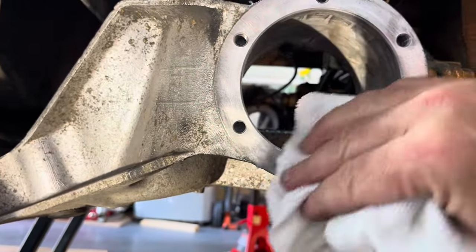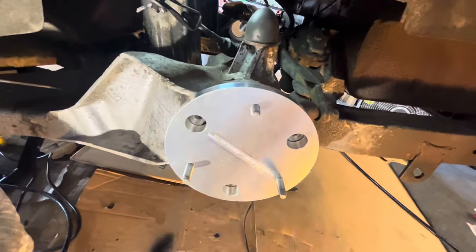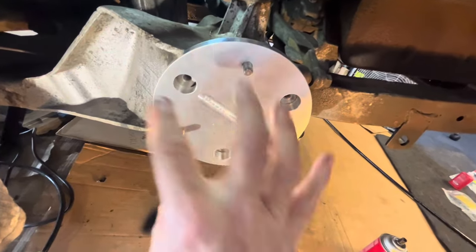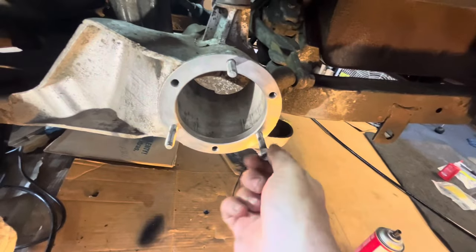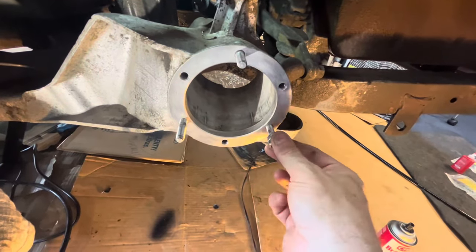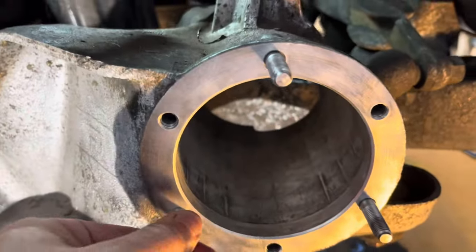The idea is you want that patent jig to sit perfectly flat — you don't want to take any chance of it not being dead-nuts on. Loosely put one stud in, see where the other two line up, loosely put those on. These three will secure it while you tap the other three. Then double-nut those and get them snug — no torque wrench needed, just mechanic-snug.